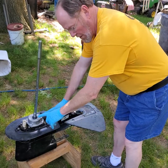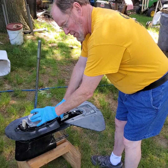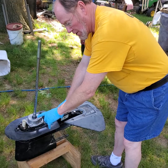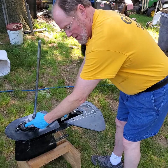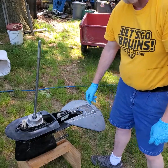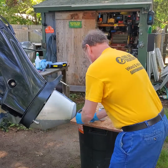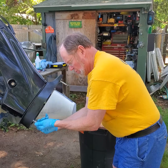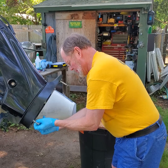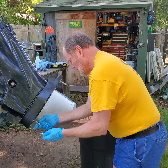I've got the lower unit ready to go on. I have my water pump slinger — I forgot to mention that earlier, but it's critical. There's a little tool that comes with it that seats it at the right pressure, keeping all the sand and debris out. It's probably what saved the last lower unit even though it had deteriorated. I've greased the splines on my shifter and my upper drive shaft splines, so I'm ready to put it on.